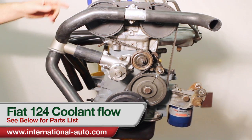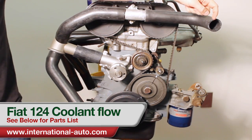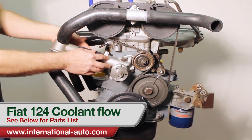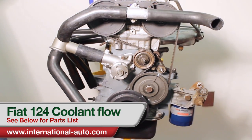The way the system works is once your water is warm, the hot water goes up through this hose, it cools in the radiator, comes back in this hose and into the water pump, then spreads through the motor and back up through this water tee and recirculates that way.